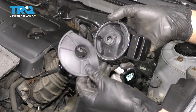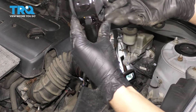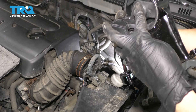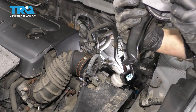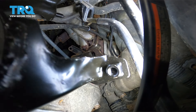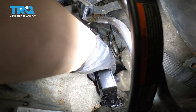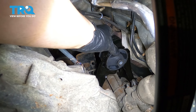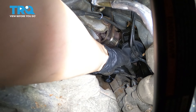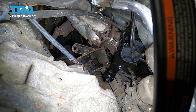Take your new mount and make sure that it has this rubber protector here on the side where it's closest to the exhaust. This is how it's going to sit down there — this basically just protects the rubber from being damaged over time from the heat. Slide it down the same way that you took it out. It's not going to be the easiest, but of course it's doable. Get it out of the way because we have to obviously reattach that bracket.